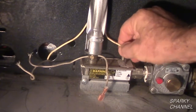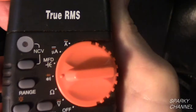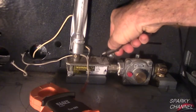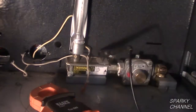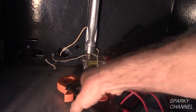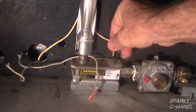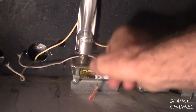Remove the terminals from the safety valve. Now I will test for continuity between the two terminals. I will turn my Klein CL2000 to continuity, then put the black lead on one terminal and the red lead on the other. The buzzer indicates continuity. The meter reads 4.6 ohms. These safety valves should read between 2 and 5 ohms, so this safety valve checks out to be good.